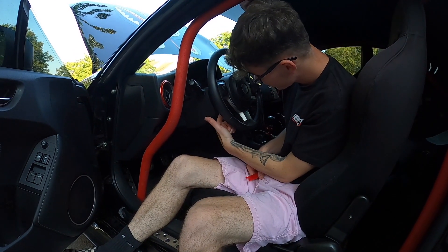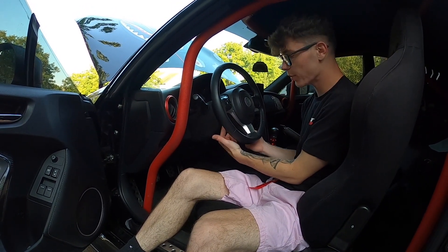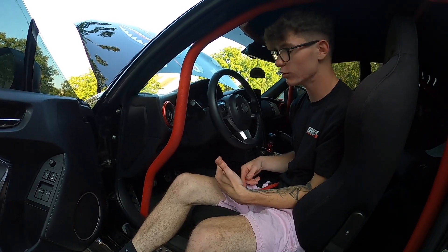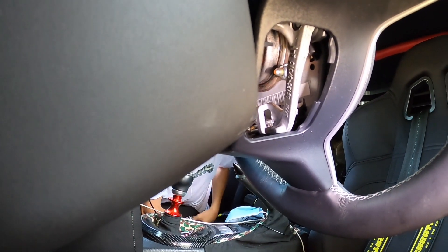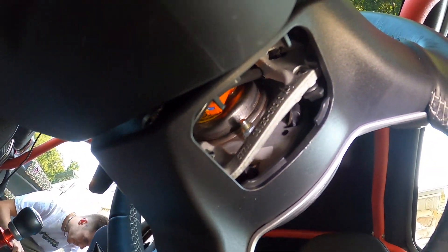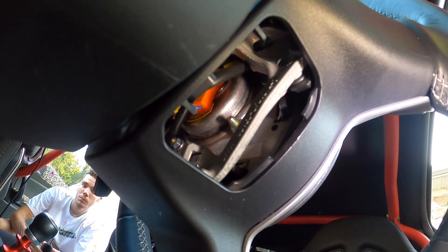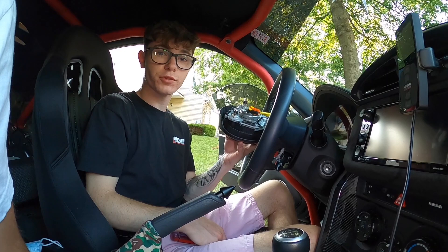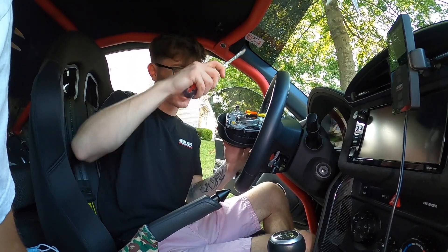The next step is you're gonna want to take this clip here on the side of the steering wheel off — there's another one on the other side, so pop that off too. Then there are some metal pins you'll need to release to free the airbag. I have the cover off now, and if you look here, the first pin is right there at the bottom — that little metal wire. The second one is right up in there; just hit it with a small plier or flathead and it'll release the airbag.